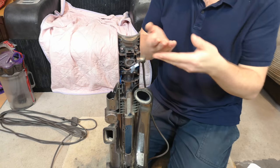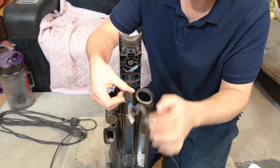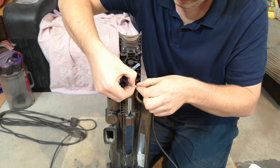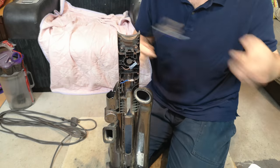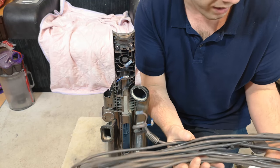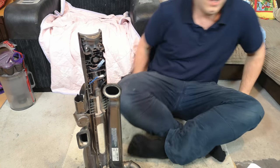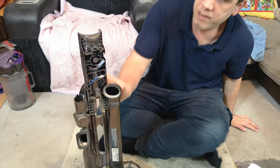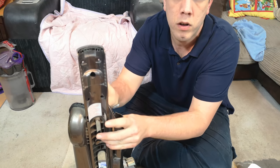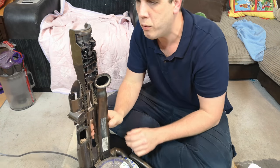That is how you repair your switch, but we want to go a step further than that, so we'll pull the cable off, open up the little plastic cage surrounding the neutral cable, and pull that off, and that is our mains cable off. The mains cable seems in excellent order, so we don't need to replace that. If you do, used very good cable, are very cheap on eBay indeed. So we can pull the wires down and then push them through to the other side and then just leave it hanging down there like so.